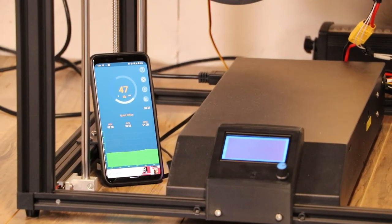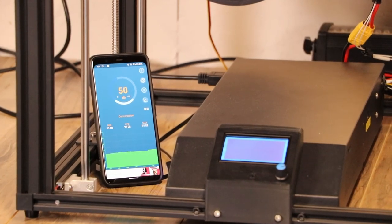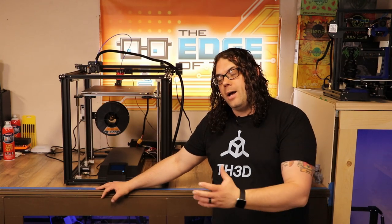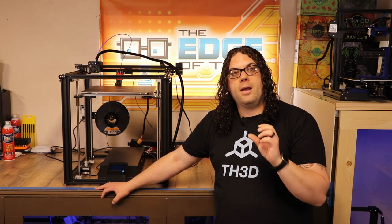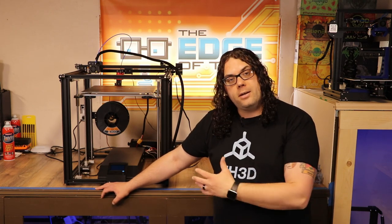As you can see, I turned it back on and we're actually hovering around the 46 decibel area. So that's almost a 10 decibel drop just for replacing that fan. I think that's definitely worth it. It was hovering around 46 to 48 decibels, and I think that's a really good drop just for replacing a fan. If that fan is bothering you, this is definitely a noticeable difference and something you might want to look into. It's a really easy upgrade — it only takes maybe 10 minutes tops front to back because you have to lay the printer down and take the whole bottom off. You lost about 8 to 10 decibels, and I really think that's a win.